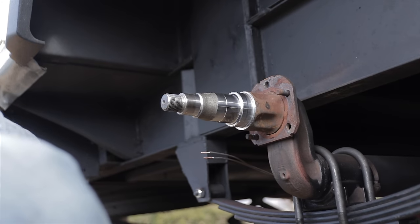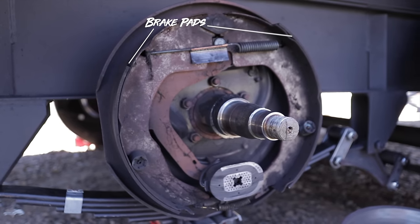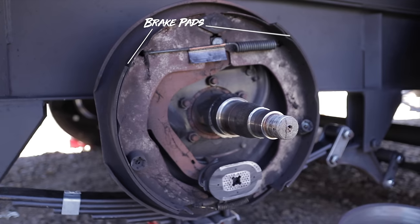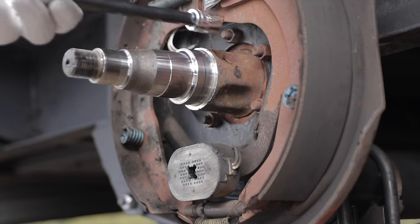You can see the offset on our axle — because of that it makes it really hard to get to the port to adjust them in the back. I'll show you that in a little bit. While we're inspecting things, we can take a look at that brake pad. It usually starts off around three-sixteenths of an inch — not super thick — but when you've worn it down to one-sixteenth of an inch, it's time to replace your brakes.